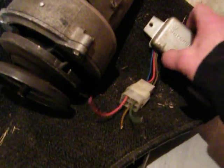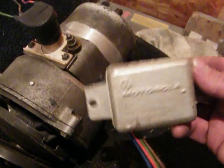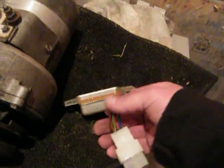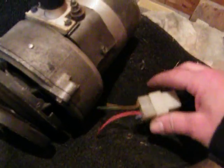Just to show everybody again — here is your internally regulated and your externally regulated regulator, which you'll find underneath the back seat of your VW Super Beetle. Here's a blue wire which comes out — it's been snipped right here, as you can see. On your original connector, there's your blue wire.